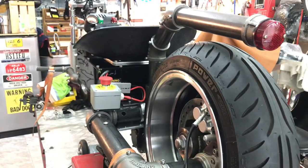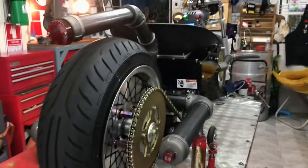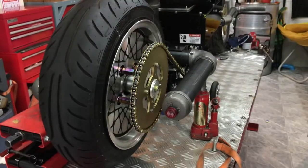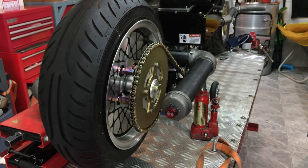The first design — I didn't intend to get that fast. But I put the QS motor 1000 watt, so it's 72 volts. It became very strong because of the ratio on the sprocket — the rear sprocket is 60 teeth, the front is 11 teeth, so the ratio is about 1 to 6. It really kicks it up.